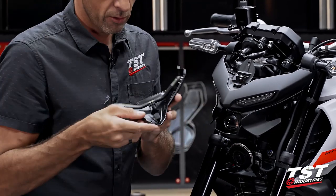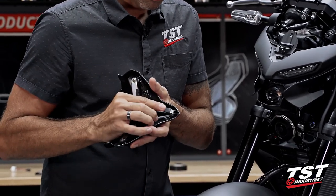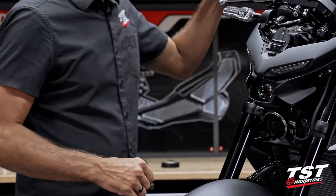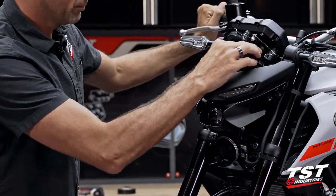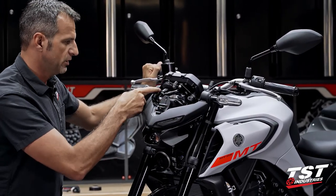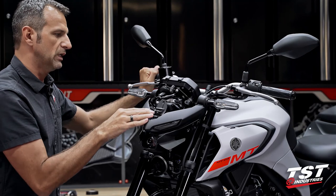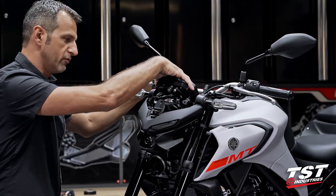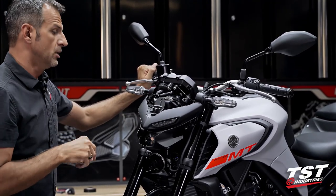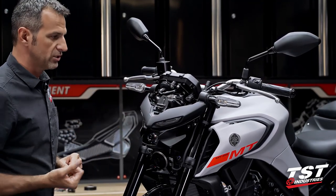This is the tab, this is the window. We do have this rubber piece — in my previous tries this rubber piece has slipped off a little bit, so I like to make sure that it's bottomed out so we're ready for reinstallation later. Now, we have all our wiring here. We'll need to undo this boot and find the plugs. However, the actual physical installation will require that we get under here. I've developed a minimally invasive way that requires the removal of the gauge cluster, which gives us enough clearance and access to these areas.